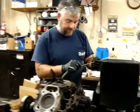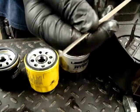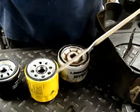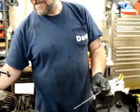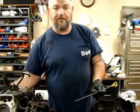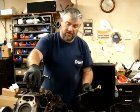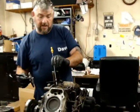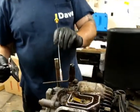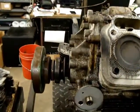On the dipstick, you do not want to run it over the full level, because the actual oil circulation and breather assembly for crankcase ventilation is low on the crankcase. If you overfill it, you blow seals out. You cause oil leaks through your breather assembly, which will run down the back side of your oil behind the number one cylinder and down the back of the block. It will also cause you to blow out your rear main seal, which I fixed recently.